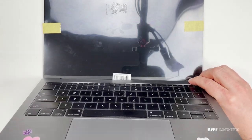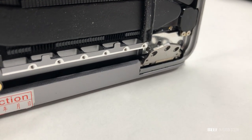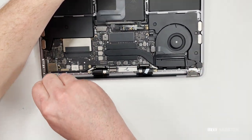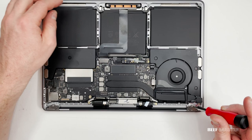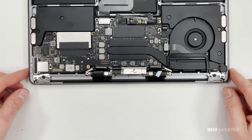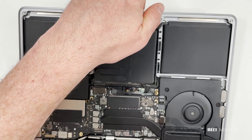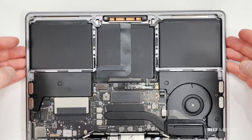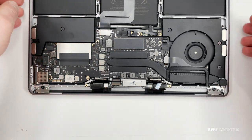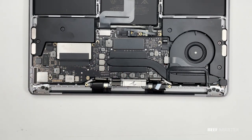It's very important that the hinges are greater than 90 degrees so you can slide in the bottom motherboard. Carefully adjust the screen until it locks down in place. Once it's set, grab your screwdriver and close the hinges — go back and forth between the hinges and carefully pry them down until you're able to completely close the MacBook. Once you can close it, only put in the middle screw and don't tighten it all the way. With that one screw holding the hinge, open and close the MacBook so it will align the screen to the bottom of the computer. Check that the edges align squarely, then tighten the hinges. These are major pressure points when you open the screen so they can easily come loose.